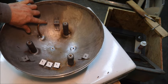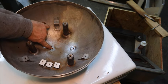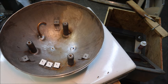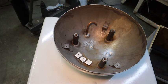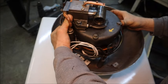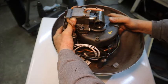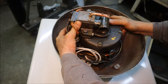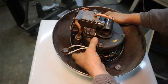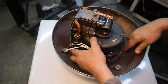I've set the compressor in here already and formed the discharge line where it doesn't hit anything, even when the compressor moves on the springs. Got the oil drain plug trimmed off flush so it'll drain the maximum amount out, and got this cleaned up for the discharge line. Time to set it in there - the trickiest part I foresee is getting the discharge tube to slide through that little hole because everything has got to go in there kind of at the same time. It felt like it went in.